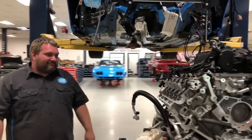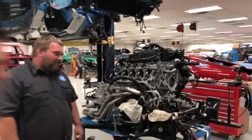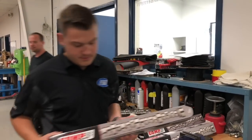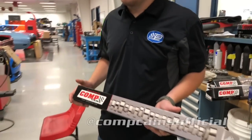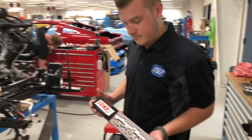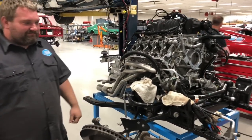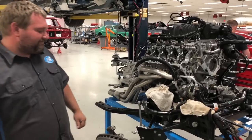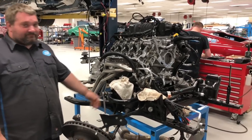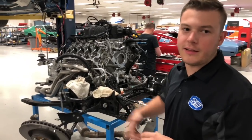What kind of cams we got in there? Stock cams are coming out and comp cams are going back in. This is a custom grind blower cam from our friends at Comp Cams — they custom grind them for us. It's specific for this application so we get everything we actually want per spec with our engine builders, as well as make our tuner happy when he gets on the dyno trying to make some power numbers. And it helps give people that lope sound that they like a lot.